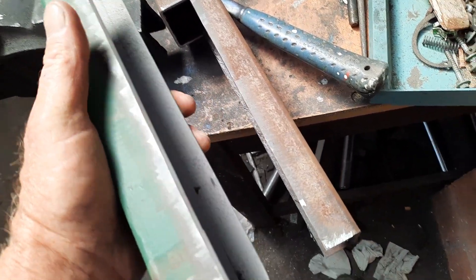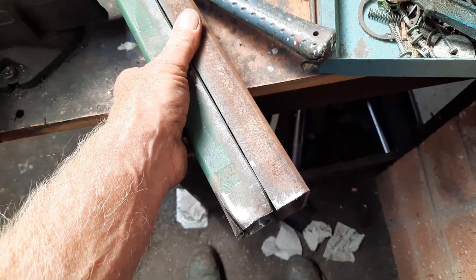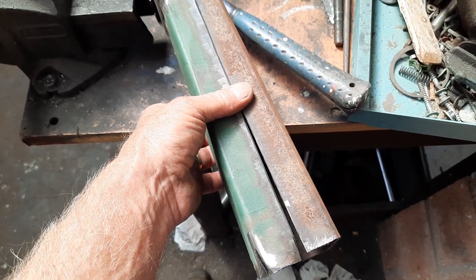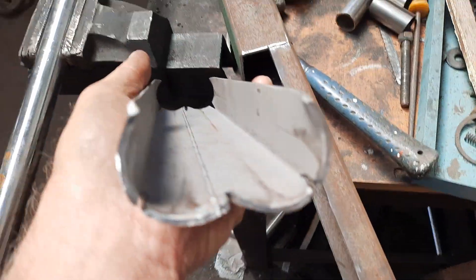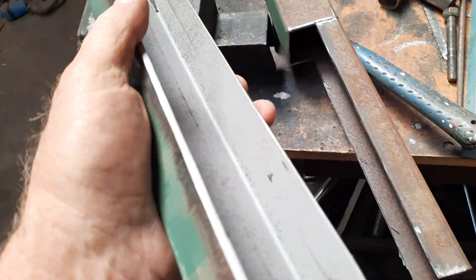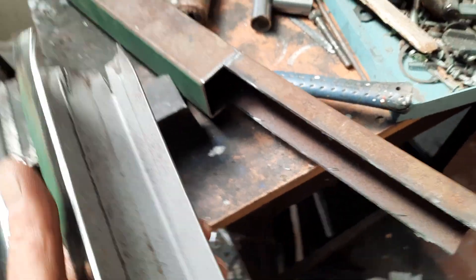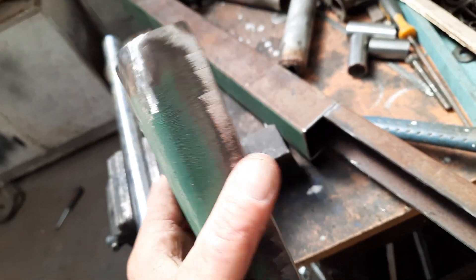You can get all these bits - it's far easier to clean when it's still attached to the main piece and in the vice, to scrub the paint off, than once you've got it off. The other thing I've done is beveled the edges, and I'll bevel the edges of that before I attempt to weld it back on. It's also been in the sandblaster to get rid of all that scaly rust. I'll clean it up a bit more after I finish welding.